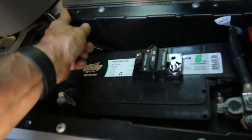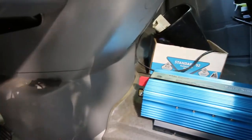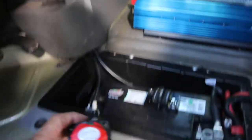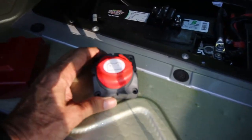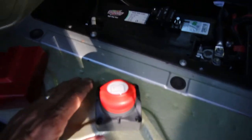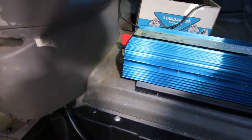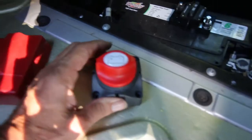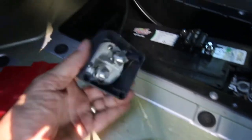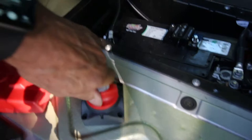Coming out of it I'm going to be going over this way, up under here, and then into the next device — this little fella right here. This is an on/off switch for 12 volts. Rather than just taking the power cable and hooking it right up, getting a big arc like arc welding — hopefully you've got safety glasses on — it's better to have it where you go through an on/off switch which controls the 12 volts so that it turns on in a nice safe way.